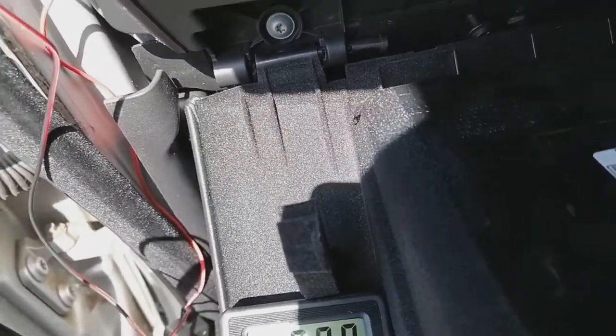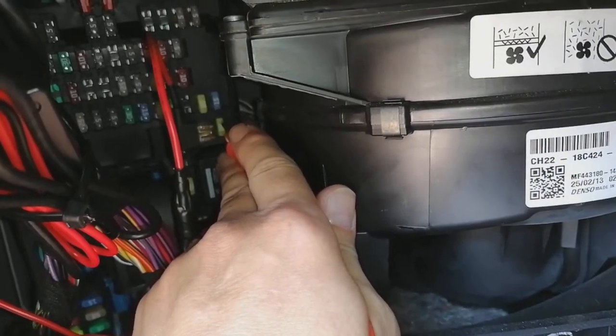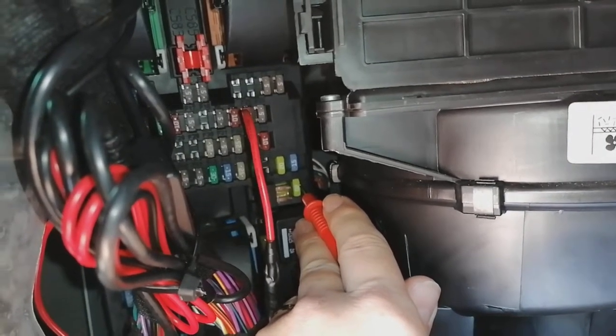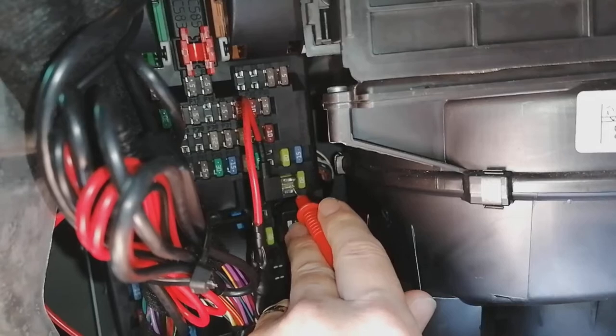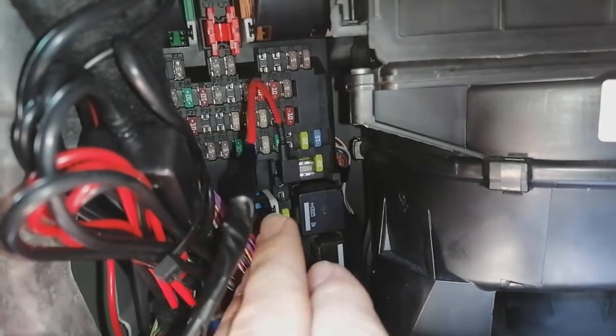What you do is put the earth black cable out and then, with the ignition off, touch the top of the fuse. If it's showing no power on your display, you know that's a dead fuse with the ignition off. When you turn the ignition on it should show over 12 volts — that confirms it's an ignition-switched fuse. We've pulled the fuse out, popped it in the fuse spur next to it, and you've got your power feed coming off the fuse box without disturbing any of the manufacturer's wiring, no complicated soldering. It's fully fit-and-forget and reversible — no damage to the car at all.